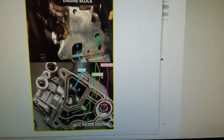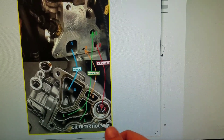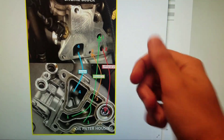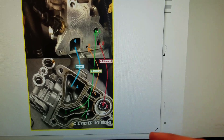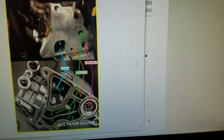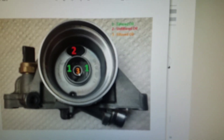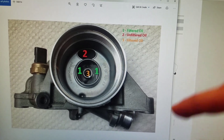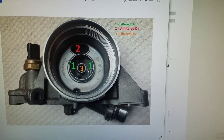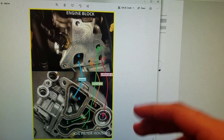As you can see right here, this is where oil comes out from the oil pan. This is a check valve which pulls oil out but doesn't let it go back down. The oil gets filtered and comes out of these two holes as filtered oil, going into the engine through this third hole — the center hole in the oil filter housing. Port one is where filtered oil is supposed to go into the engine. If the insert is missing, oil pressure leaks back into the oil pan instead of going into your engine.